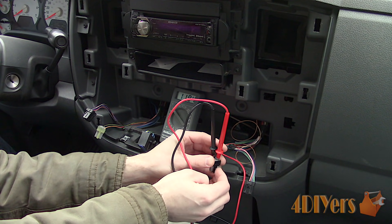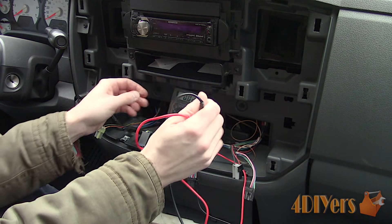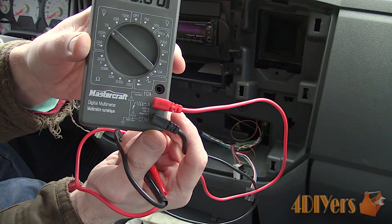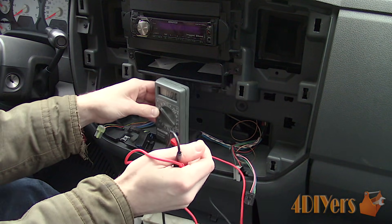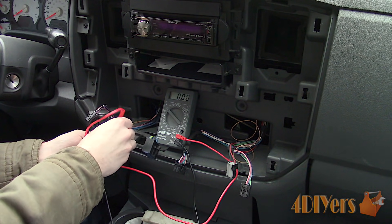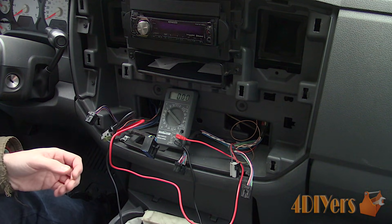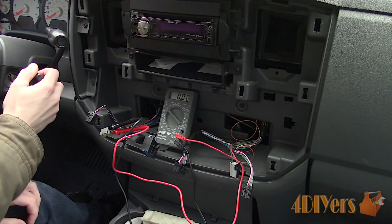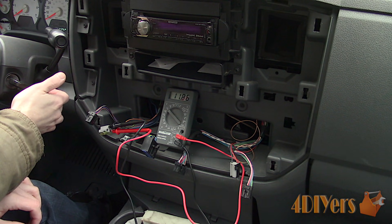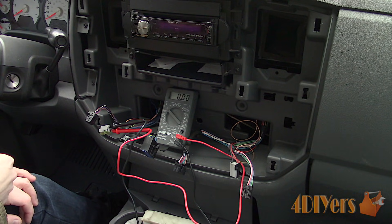If the value was negative on the meter readout, this means the polarity is mixed up — the positive lead is on negative and the negative lead is on positive. When the leads get switched around the value will be shown as positive, meaning the black lead is on the ground and the red lead is on the positive. This will need to be known when connecting the new port. With the probes stuck on the back of the connector to stay in place, turning on the ignition the circuit powers up right away, and once the key is off the circuit turns off as well.